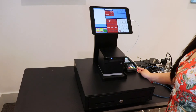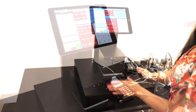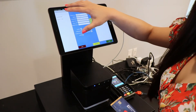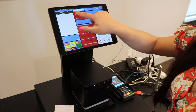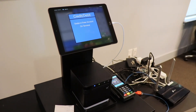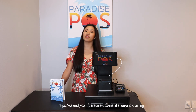After we've connected all the equipment, we'll test everything to make sure it's working properly. For your cash drawer, you'll just want to hit the orange open door button in the bottom left corner and your door should pop open automatically. To test your printer, go to Admin, then Printer Maintenance, select the printer that you're working with, and then hit Test Print at the bottom of the screen. To test your card terminal, you'll ring up a sale, take it to the pay screen by pressing Pay, select Credit, and then the terminal should prompt you to swipe or insert your card. If it's got a chip in it, go ahead and insert it in the bottom; otherwise you can just swipe it. If you're setting up for the first time, go ahead and schedule a phone call with our dedicated install and training team so that we can walk you through the entire process as well as training over the software.